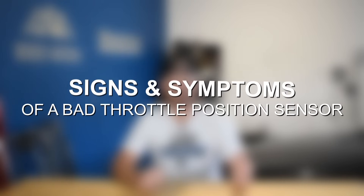Jumping into the signs and symptoms of a bad throttle position sensor, you're going to notice things like rough idling, jerky or hesitant acceleration, and a loss of power. You might have engine stalling issues or issues where you can't get your engine to rev beyond a certain RPM, or when you're driving you can't get your vehicle to go over a certain speed. In addition, because the throttle position sensor is supposed to check up with your accelerator pedal position sensor, when those readings are off, you are going to get a check engine light.